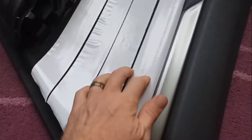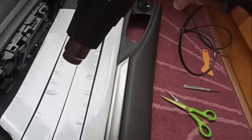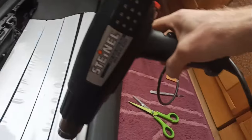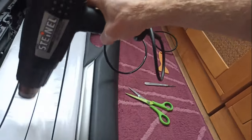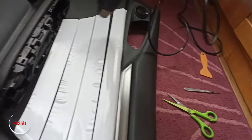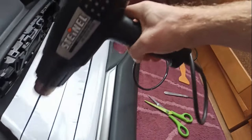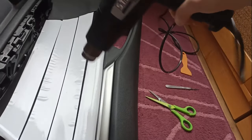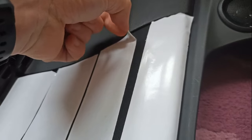I use double-sided tape — it looks like this. I will be putting one more here, but before I put the double tape, I heat it up, and I will also heat up this mistake. Because once you heat it, you will melt the glue and you can be sure it's holding properly. That was the first mistake I made when I did it outside in the cold — it doesn't hold properly on this fabric material. Now it should be all right. You can test it a little bit — you see it's thick already, but you need to melt it more and that should be fine.